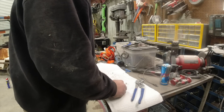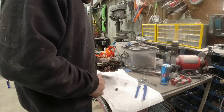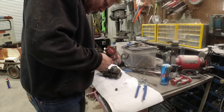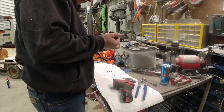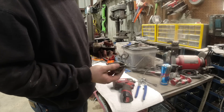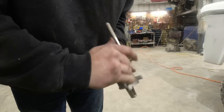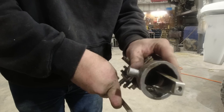I may have sealed my finger a little bit with that. Unless there's an Allen on the inside — which I doubt. We've got the carb out, let's go ahead and open it up and see how the needle's doing. Don't break off — better luck with an impact just getting a good bite. Trying not to break it off with a screwdriver. The float is stuck. I got that nipple thing out of there, drilled her out to 21/64, so we're on an eighth-inch MPT tap through there. We're just gonna put an elbow on this thing because that was a dumb design.